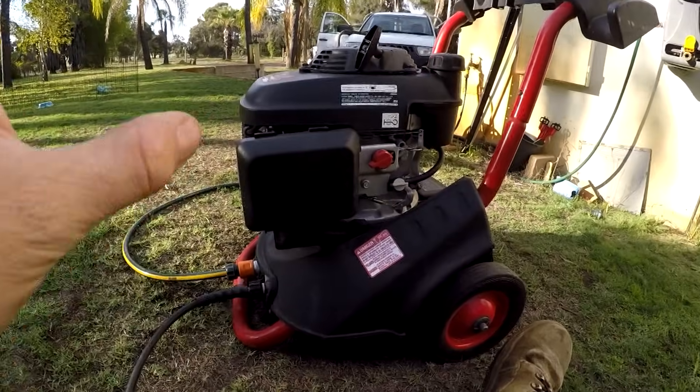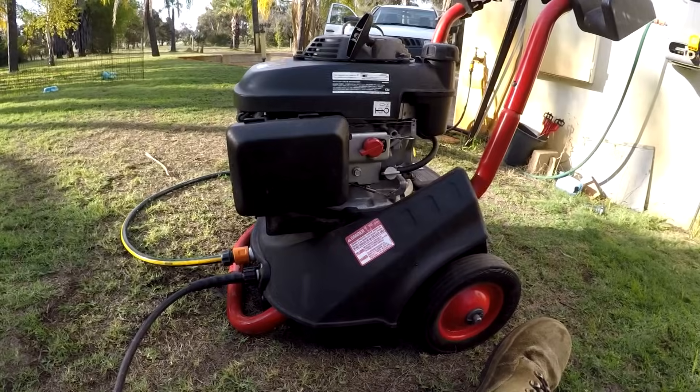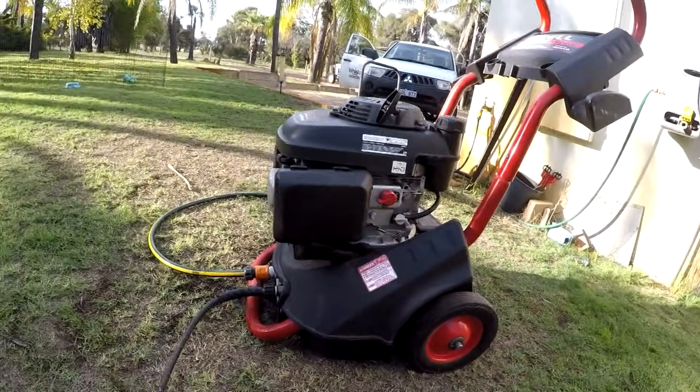It's a very common problem for Honda GCV 160 engines - they surge quite a bit. That's the problem when you leave machines for over 12 months. When I purchased this machine it had been in storage for 12 to 18 months. These are the things you take on when buying secondhand equipment - sometimes they may not run right due to wear and tear. Hopefully that answers your problems. Use a fuel additive to clean your carburetor and it'll run right. Hope you enjoyed this video - if you did hit the thumbs up and subscribe for more lawn care videos. My name is Hayden and I'll catch you next time.